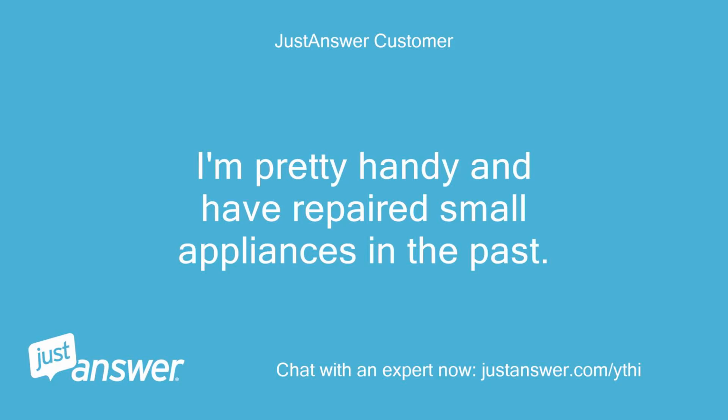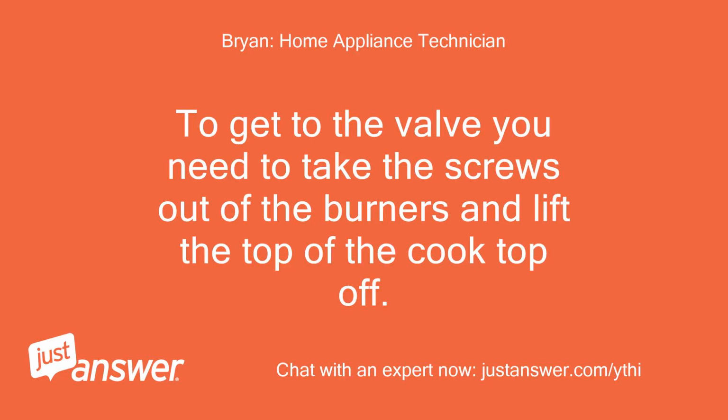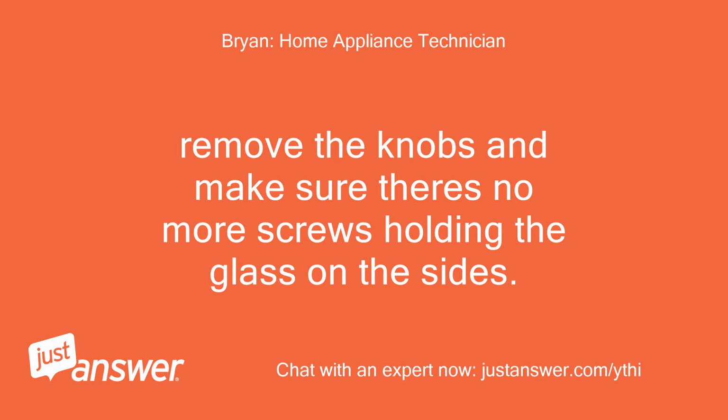I'm pretty handy and have repaired small appliances in the past. Do you have a part number, and how do I get to the valve? To get to the valve, you need to take the screws out of the burners and lift the top of the cooktop off. Remove the knobs and make sure there are no more screws holding the glass on the sides.